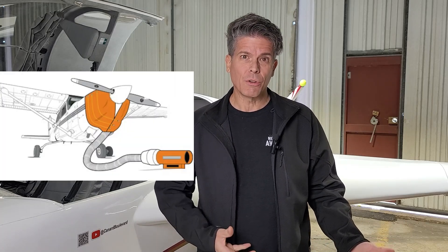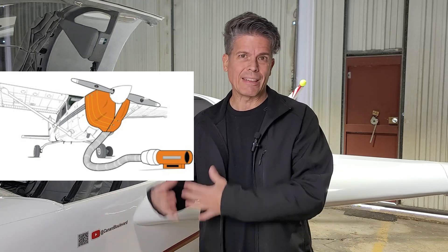The last installed kind is a newer one — I believe it's made by Aero Splat — it's a bolt that replaces one of the drain bolts in a Lycoming that has dual sump drains, and again it just heats the oil. Those are four types of permanently installed preheating systems typically found in airplanes. Then you have portable systems. One is simply a hot air heater that blows hot air up into the engine compartment. Then you have combustion heaters like a torpedo heater, typically found on the ramp, propane-fired, which fires heat through a hose into the engine bay. And the last is a light bulb — used by people who leave it on all the time with a blanket over the cowl. Incandescent bulbs that actually generate heat are getting harder and harder to find, so that's probably not used much anymore.